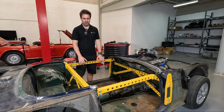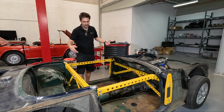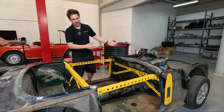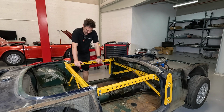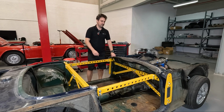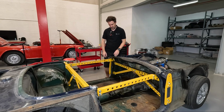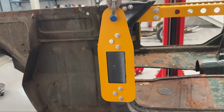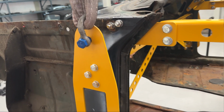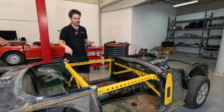It provides the bracing to the body shell during the lift. So yeah, very traditional, the door bracing, and in my case, the extra effort of A and B pillar lines of bracing. But the step beyond that is it's the frame itself that you lift from. So the frame provides, by virtue of these two side plates, the hole at the top of the plate is where I'll lift from. And then on the B pillar line, in this beefy bracket, there's a hole that I will put another shackle through and lift from here. So I'll lift from those 4 points.